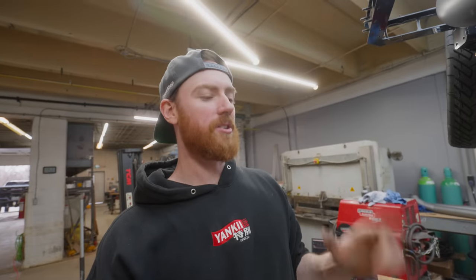I'm 3D scanning the engine compartment. This alternator with this setup doesn't fit in a very comfortable spot with good heat management, so I'm scanning the alternator and the engine bay. I also have to make engine plates that avoid all of the exhaust. I've got a bunch of designing to do today so we can blast it out on the water jet and get Dylan on machining the stuff so we can mount the engine — that's the stuff that takes the longest. Everything else like fuel lines, water lines, and oil lines can be done by someone else. This is the stuff I have to do, so that's what I'm focusing on.